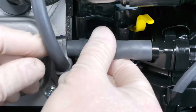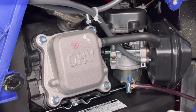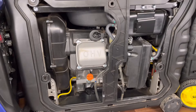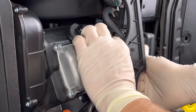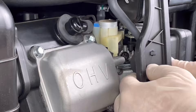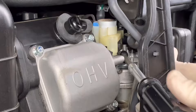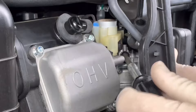We're going to move over to the Predator real quick first, since this generator is almost identical to how you would do the Westinghouse — all you have to do is remove the hose and do the same thing, so we're going to skip the Westinghouse and move to the Predator. I've seen some people remove the airbox to get to the carburetor, but you don't really need to. This support bar is in the way, but you can put your hand behind it, press against the airbox, and get a little room to work. We'll remove that hose, tuck it up and out of the way, then use a long Phillips head screwdriver while prying out on that little support bar. We put the throttle stop screw all the way to the seated position — this one was set at about four and a half turns out.